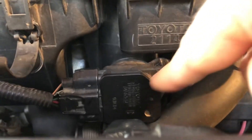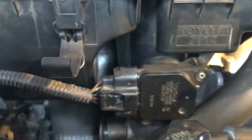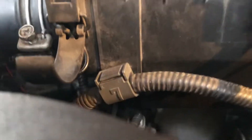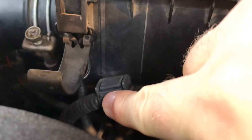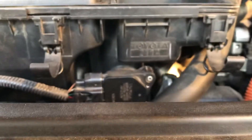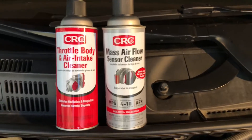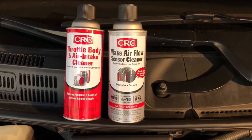Down here it'd be kind of tough to see — that little thing right there, inside this little orange light bulb. If yours has been driving for a while, it'd be pretty black. To take that out, I would take this out first. There's a bolt here and another one down there — just use a little baby screwdriver, there's not much space. I had to really gently but firmly finagle it out with a little wire harness. You push this thing down and gently click it. Then you put a flathead screwdriver in between this little space right there, between the top and the bottom, gently push, and it'll pop out. Take the wire harness out. Once you unscrew it, put it somewhere very safe. Then just take this can of cleaner and spray it all over it — it smells really bad, don't get it on yourself. Spray it all over, let it dry somewhere with good ventilation, and you'll be good to go. Then pop it back in.